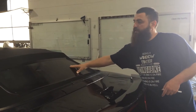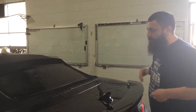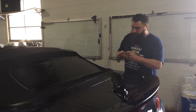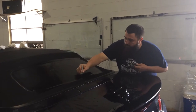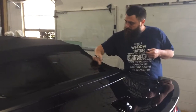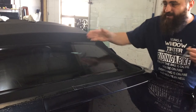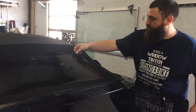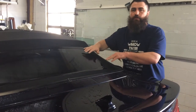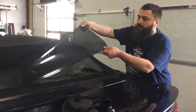Coincidentally, you don't have to shrink this glass, but a lot of newer guys have issues cutting it and getting it to fit right. What I do is I'll lay the film on here and I will take a marker and run it all the way around the edge, just like that. I've already cut and marked the whole thing — I was just showing you that as an example. But if you just take your knife and cut right here and right here, when you go to put it in, it doesn't necessarily fit properly. So the reason that you mark is so you can know exactly where to trim it.